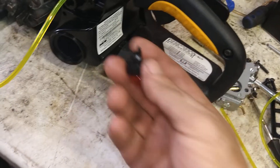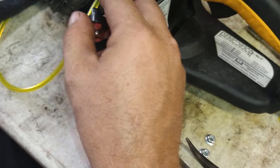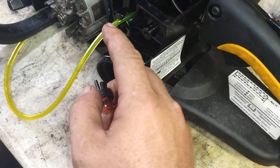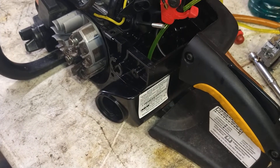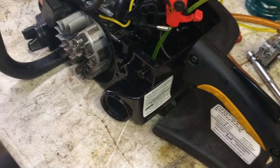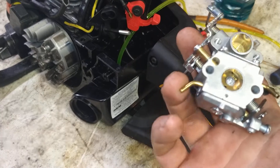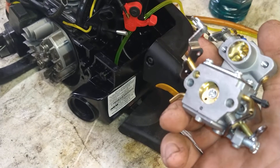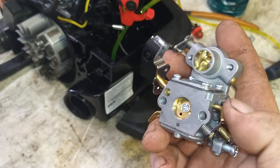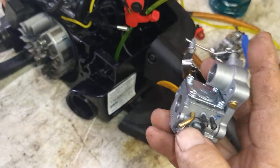Primer bulb: the short nipple is what goes to this line. Actually, wait - I'm wrong. Nothing goes on this at all from the tank directly. This goes to the carburetor, not the primer bulb. The primer bulb pulls through the carburetor. So basically the fuel pump side - the fuel line will go to that side, and then this will go to the short nipple. When you push the button in and let it out, it pulls through here - it pulls out of the tank, through the carburetor, out of here. That's what we're going to do. All right, next line first.